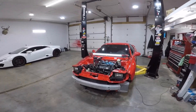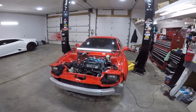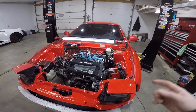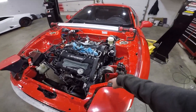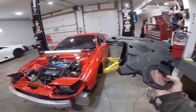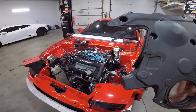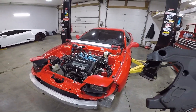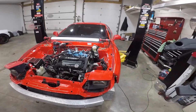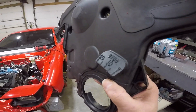Back out here, going to do whatever it takes to get this thing started. I talked about this at the end of the last video — I gotta take all these pulleys back off to get the timing cover on. I was gonna leave it off, but I have to take everything back apart to get the cam gears off because I'm doing adjustable cam gears after this engine's broken in. The timing marks are on here so I gotta get it all back apart. I also want to paint those because they were kind of hard to see last time.